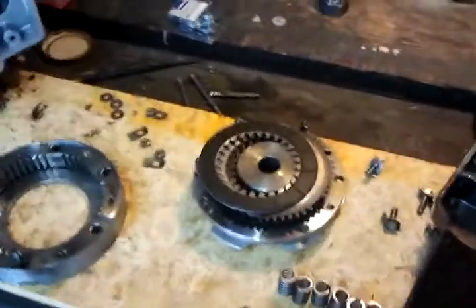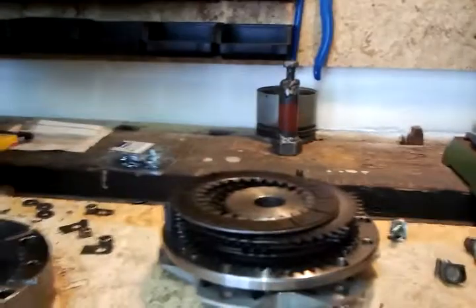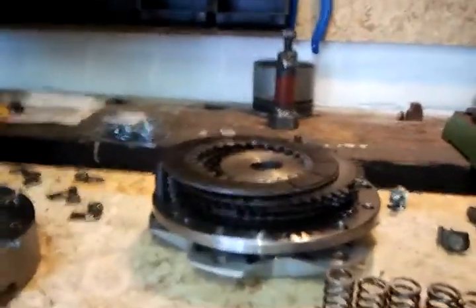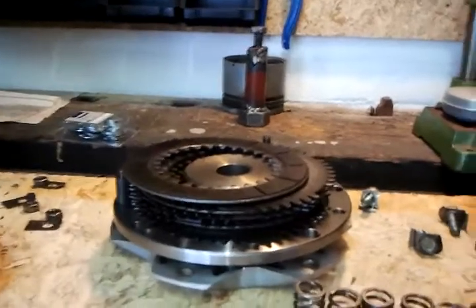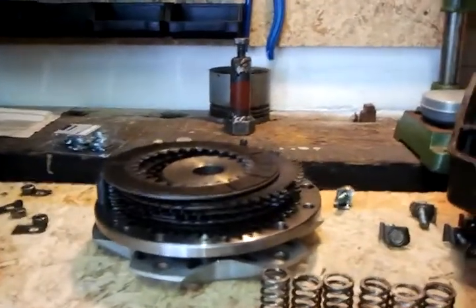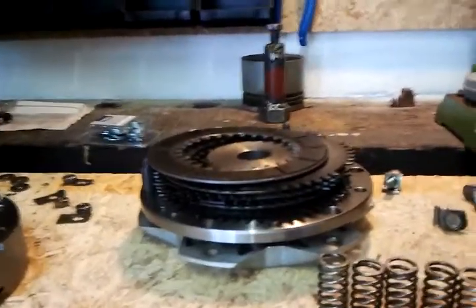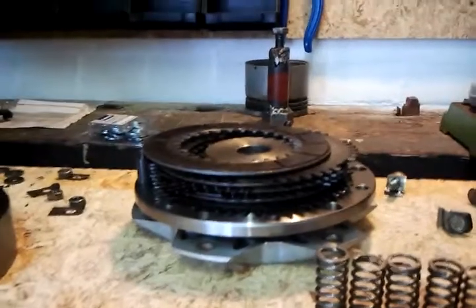What I think happened is that possibly I once swapped the engine oil — about a quarter liter — with what I had available at that time, which was not the original grade oil. I had to use standard motorcycle oil and not transmission oil. My thinking now is that this one-time use of doped, partly synthetic, modern engine oil ruined my clutch, because that clutch was never designed for such a high-grade oil.